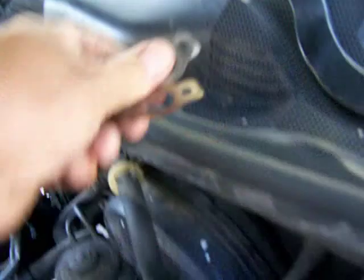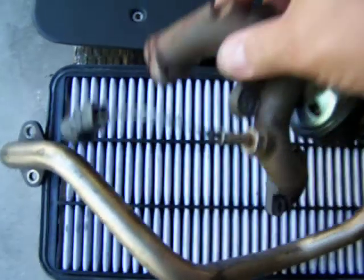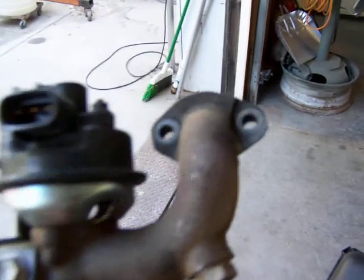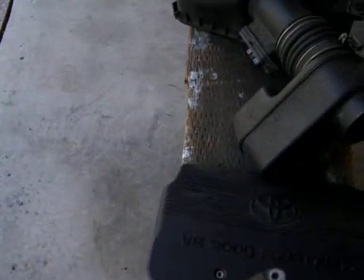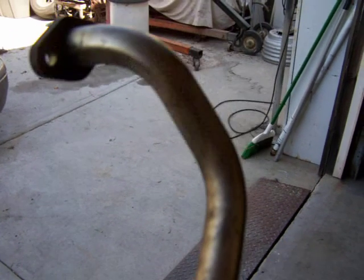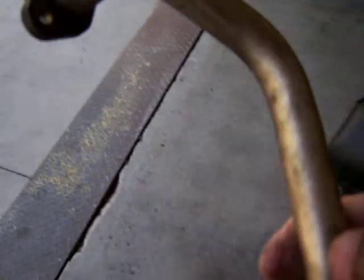You'll see these two gaskets that go to the EGR tube. Here's a quick shot of the stuff that came off. This is the EGR — it mounts like this. You take off those two bolts, and on the bottom you have the pipe. One of the studs came out and fell into the car — hopefully I can find it. This tube mounts just like this. I took the bottom one off before removing the valve cover and it's pretty cut and dry — it just comes right off.